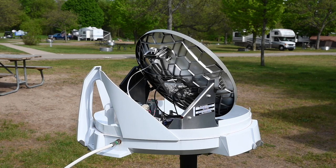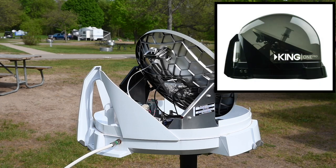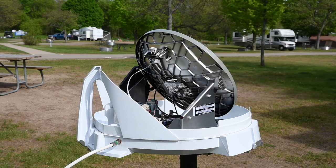It's unfortunate that you cannot see what the antenna is doing during setup and operation. If that was possible, you could watch the behavior of the antenna and determine where it is pointing and if you should move to a better location. King does make a translucent dome version, and I would recommend that model if you are in the market for a satellite receiver. In fact, I think I will contact King and see if I can buy just a new dome as a spare part. I hope this video was informative and perhaps gives you a better understanding of how the antenna works for your satellite system. Thanks for watching.